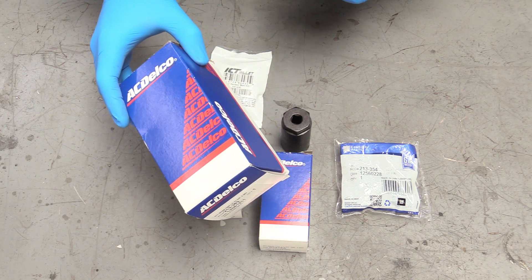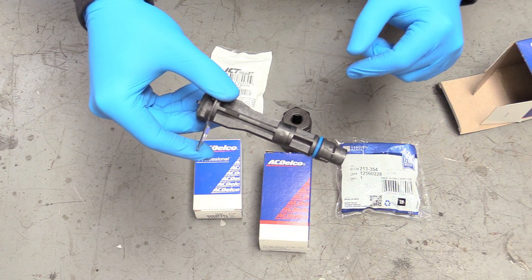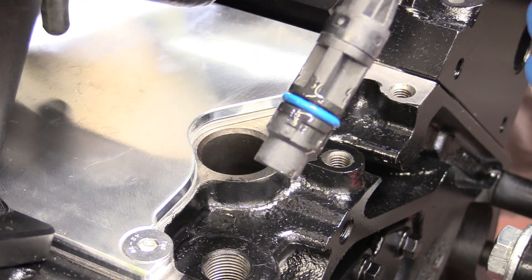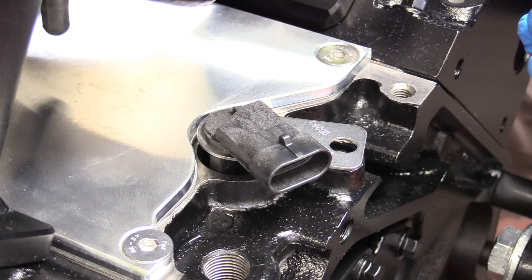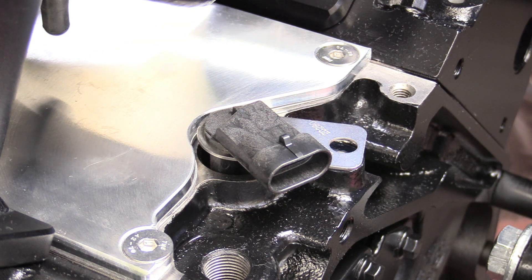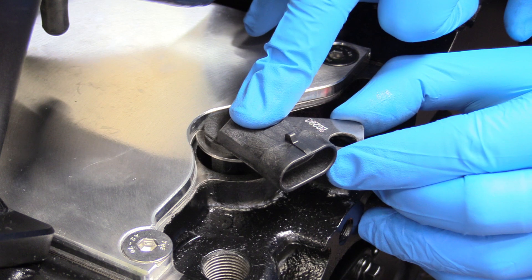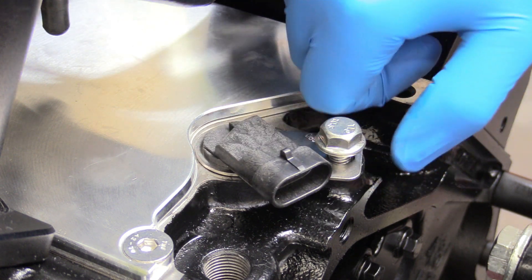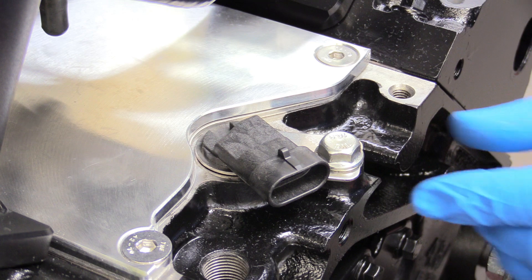Let's go ahead and start off with our camshaft positioning sensor. Before we install it, I'm going to put some oil on my fingertips and just apply it lightly to the O-ring. Never put an O-ring in dry. Over here where our camshaft positioning sensor is going to go, we'll go ahead and remove that tape I had placed there earlier. If you have a stock intake manifold, you have to put this sensor in first because the intake manifold will be in the way. Our aftermarket one alleviates that, so we have that luxury. Just gently push down on it until it makes that very gratifying clicking sound, line up the bolt hole, and place one of our bolts back in there. Then grab our 13 millimeter socket and just snug that on down. No real torque spec — just snug is good. All it's doing is holding a sensor in place.